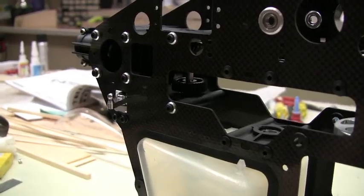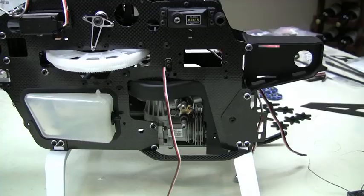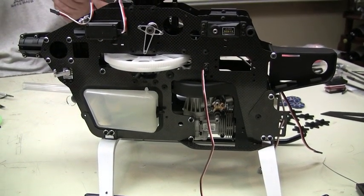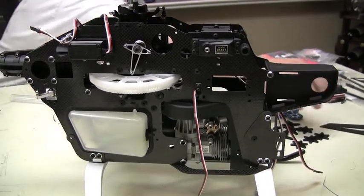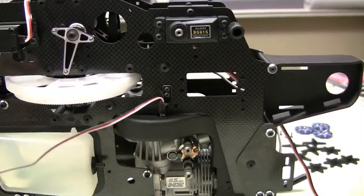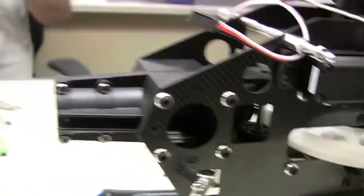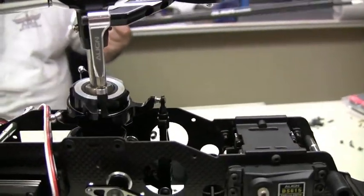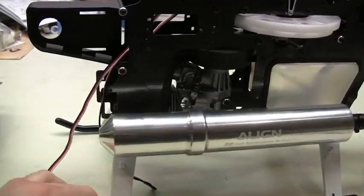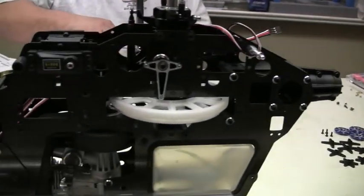The new black gears are also installed from the factory. We have the DFC 600 Align Nitro motors in place. We have the sensor for the governor in, main gear's in, and the black gears in there for the PTO. We have tail cases in, flybarless head is in with the new swash plate. Servos are in, front servo trays installed. The Align muffler's on. Joe's in the background assembling the boom and tail rotor assembly, and that'll be going on next.